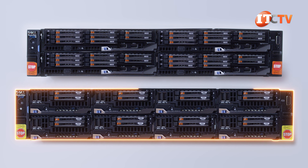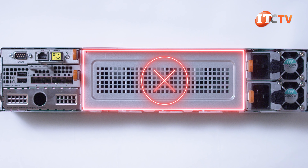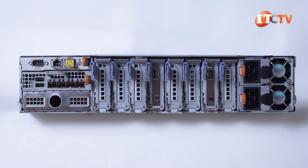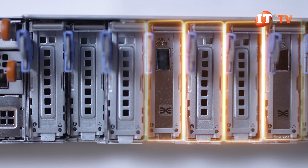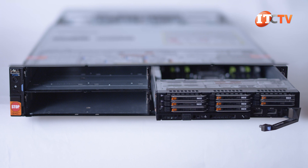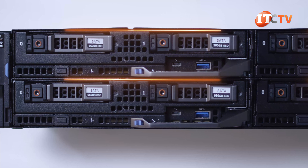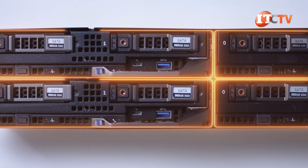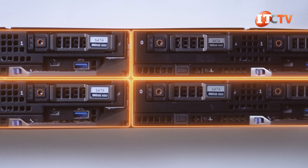There are two FX2 chassis. The one without the S is the unswitched version with no PCI slots — it offers a cost-effective alternative to the FX2S, which supports up to eight PCI slots. The FX2S automatically maps a specific number of PCI slots to the installed server nodes. Both are converged infrastructure chassis with power, network connections, management, and cooling handled at the chassis level, while the server nodes provide compute and storage.